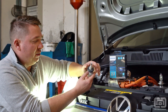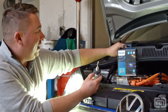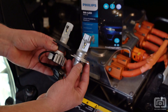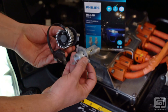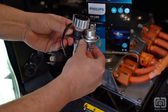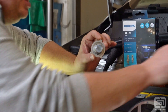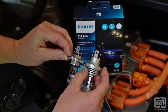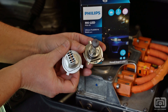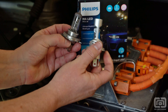But with the new generation, that changes because it's completely different in structure. The retrofit lighting system is made up of two distinct parts. Generation 2 looks completely different when you actually get to see it up close. In the front area, it's much more massive and constructed from robust aluminum — though it appears like plastic, it's made entirely of aluminum, giving the clear benefit of efficient heat dissipation. Turning it around, there is no longer any fan visible at all. In the back area, it's almost one-to-one identical to a classic H4 lamp — sticking out just a tiny bit more, only about three millimeters.